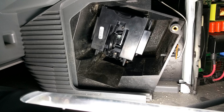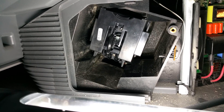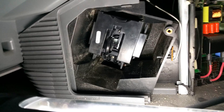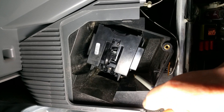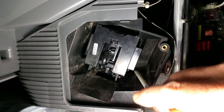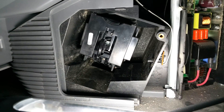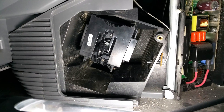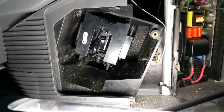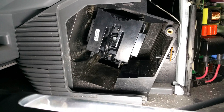This is a 10-year-old television set. I am going to insert that, but also while I'm here, another possibility which will cause the same symptom — the three red lights blinking — is a micro switch at the interface level where the bulb compartment goes in, not the bulb compartment, but the bulb housing goes into the bulb compartment.